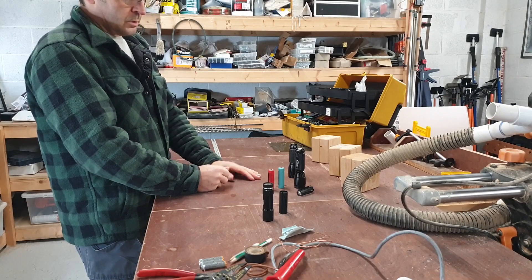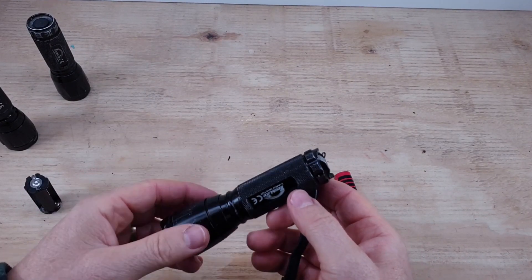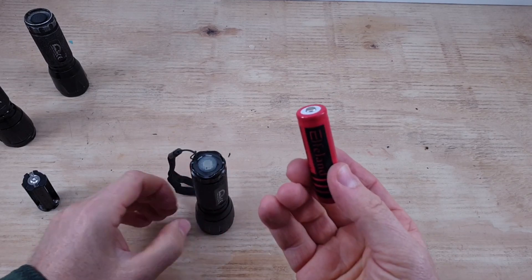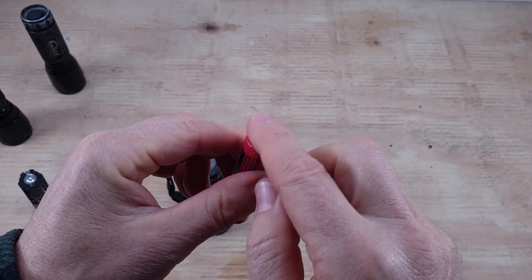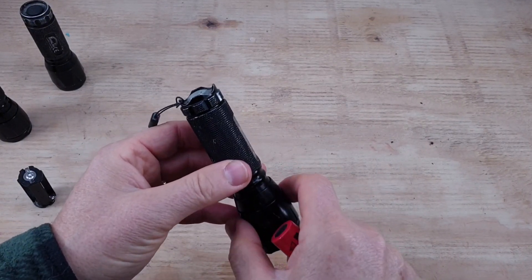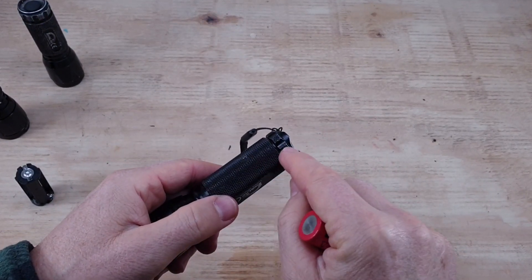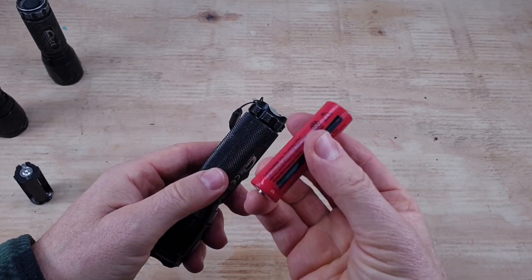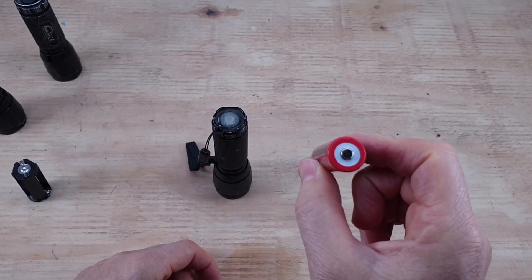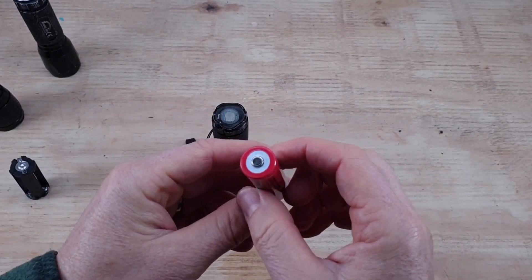It's really simple to do. To do this, there's a couple of little problems that we've got to overcome. The first one is, obviously, this is longer than the cassette that comes out of it. Also, a lot of these, especially if you're using ones out of laptops, they'll have a lower pin, and there's a shoulder on the face of the actual LED driver cassette. So we've got to grind that down, and there's a spring in here with another collar - we've got to remove that to get the space that we need. The other problem is this thing is narrower than the cassette, so it's going to rattle around. We've got to create a sleeve to stop that movement.